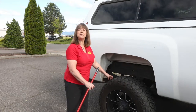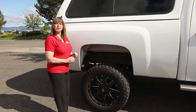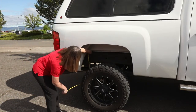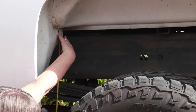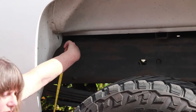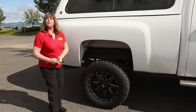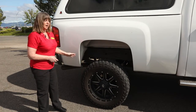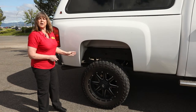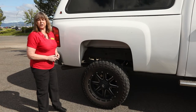Anyone looking at your mud flaps from behind you will see that they are totally centered on your tire. Of course, we need to measure for the length as well. So we're going to measure from that same factory hole all the way down to the ground — it is 40 inches. Again, you want to be no closer than 6 inches of the ground and within 10 inches of the ground. However, on the rear, if you are pulling a nice boat or trailer, then we recommend you be 7 to 8 inches off the ground to properly protect what you're towing.